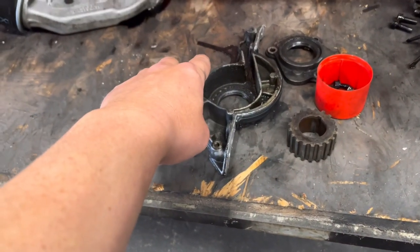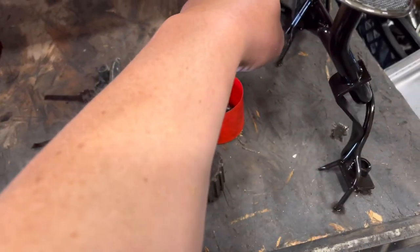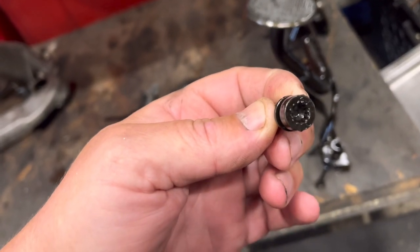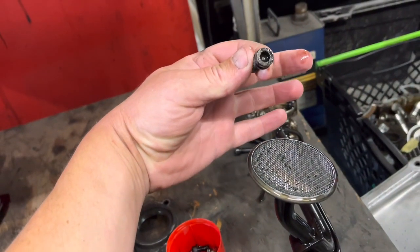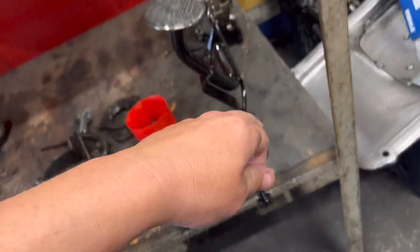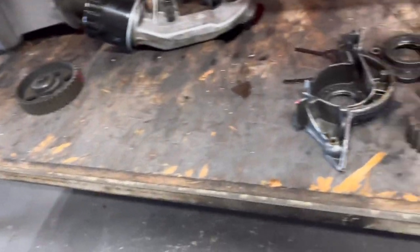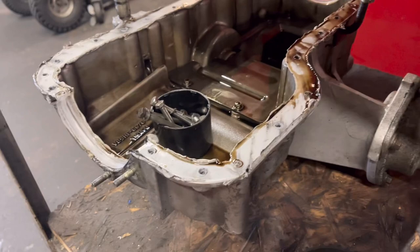Oil pump — we've got three bolts there: one holds the front of the pipe down and two hold the back. On the front you've got a normal hex and on the back you've got these multi-spline. One of the multi-splines is mullered — they've reused that. These are literally a couple of quid, so why anyone reuses these I will never know. In the back we've got a hex one side which was tight, and the mullered one on the other side which was loose — I went to undo it and it was literally loose. So the pump's been held down by one bolt and they put this mullered one to hold the front pickup down. That's not ideal. The front oil seal's leaking — whether they put a new seal in, if this motor hasn't done too many miles I'm not sure why it's leaking as bad as it is unless they put the old one back in. Now the sump — we all know this is a four-wheel drive sump and it is a face-to-face; there's no gasket on this.